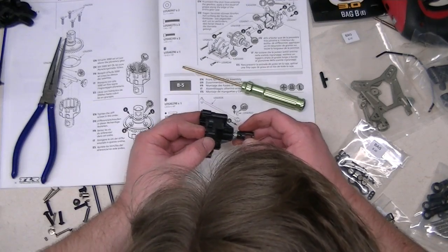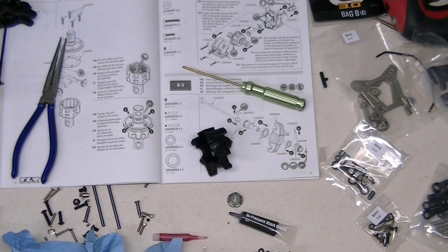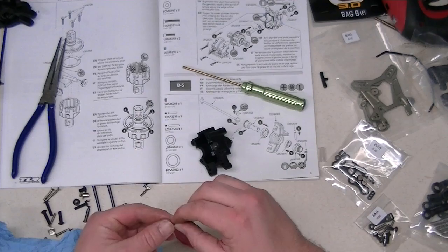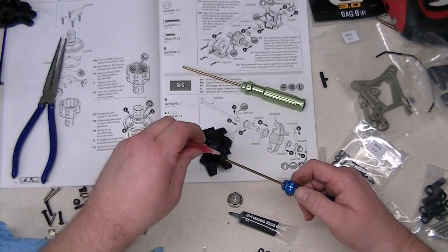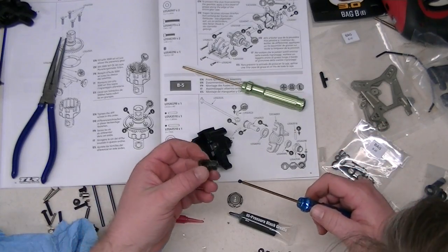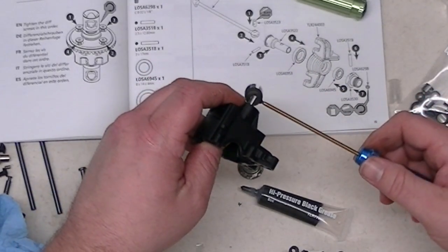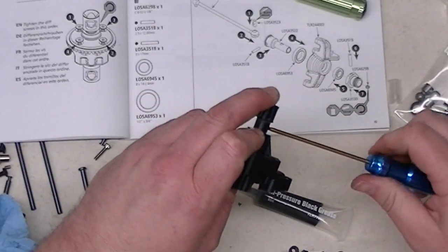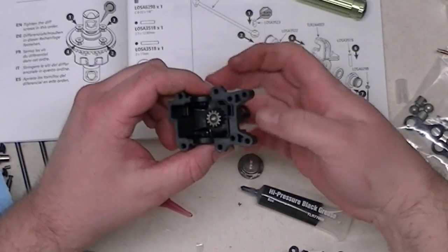And we need some Loctite, so I'm going to again spray some of my brake cleaner on the part that it's going to go into. Wipe it off. Grab my last grub screw here and add some Loctite. That's just going to go on the face right there, and then make sure to line up that little groove and shove it in. Okay, keep it as tight as you can and tighten it down. That'll keep it there. So that's that part done.